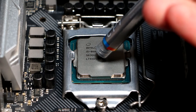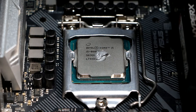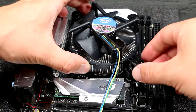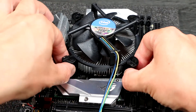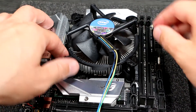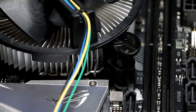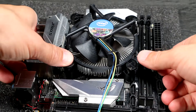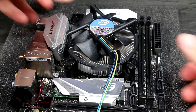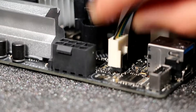If not, apply some paste now. Ensure the pins are pulled fully upwards, then place the cooler over the CPU. Locate the plastic barbs through the holes in the motherboard, then press the pins down using the thumb pads. Lock each one in turn. Ensure you plug in the CPU fan to the correct header on the motherboard. That's the CPU cooler installed.